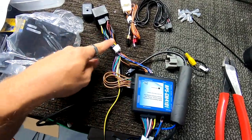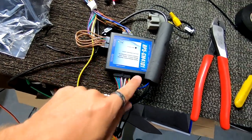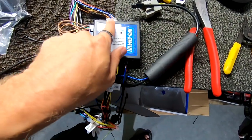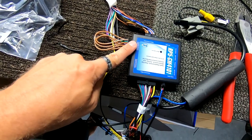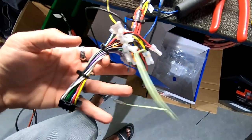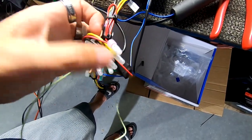Just to give you guys a brief update, we started wiring this in. We plugged this into the vehicle connector side. You want to make sure that you do your radio select beforehand so that you can plug this in. I'm on an amplified Boston acoustic, so I want to go on this side with my plug. Sorry about this mess, we're going to clean it up, but I have everything wired up from the Kenwood over to this harness side. Every single thing is standard.